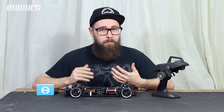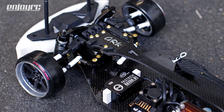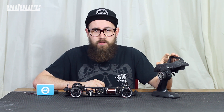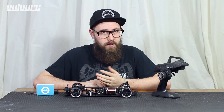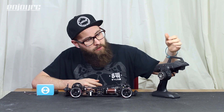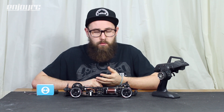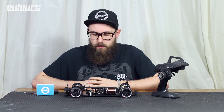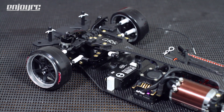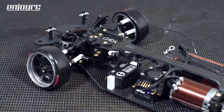This one is pretty much plug and play. I simply bolted it into my chassis, made sure the servo horn was right in the middle, chose a new profile on my transmitter so everything is set to neutral, and plugged it in. It's two wires. I switched it on and it centered by itself — no need to set up end points, no need to calibrate, it just works.